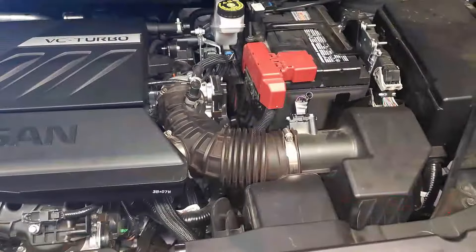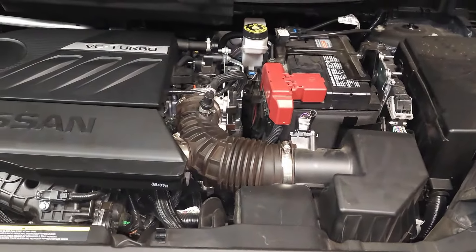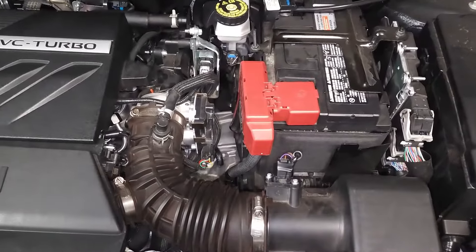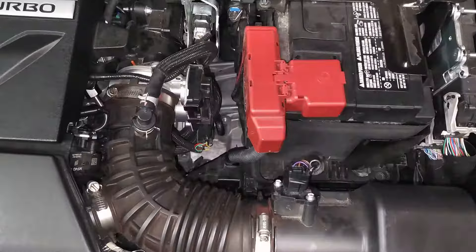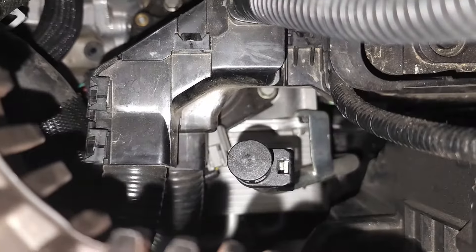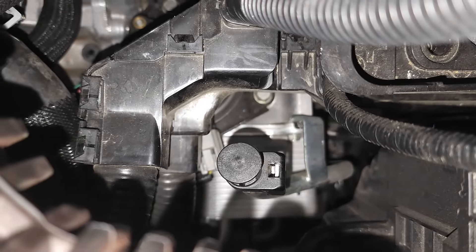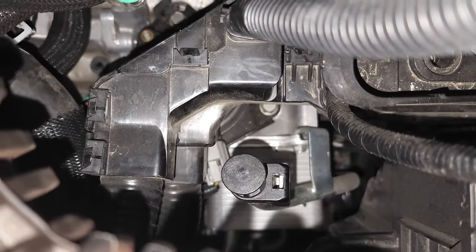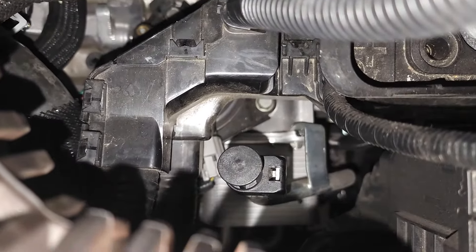Moving to the top of the vehicle — I'm standing in front at the bumper looking towards the windshield. I'm going to pan over and zoom in to the transmission port because it's not a dipstick. It's just a port with a cap on it, right there in the center of your picture. You may want to attempt to remove this cap prior to removing the lower engine cover, because if you are unable to remove this cap, then you can't refill the transmission. So think about that before you start your process. I'm going to show you what I did to remove this cap — I saw it on another video and I'll give credit to that person in the description below.